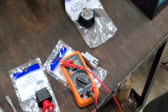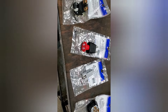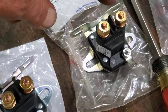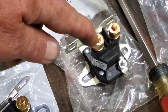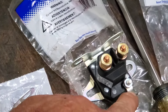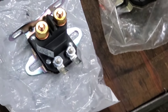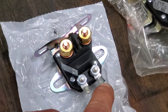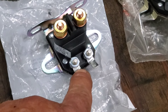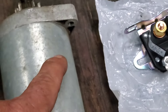Now, I'm going to show you another way to get your mower to turn over fast. Let's touch on these solenoids — you've got a four-post and a three-post. I'll put a link in the description and explain in a video how these work. That's your trigger wire: when you put power here and the frame is grounded, it'll connect that terminal to that terminal and your machine will start.